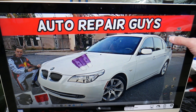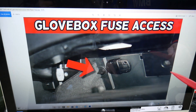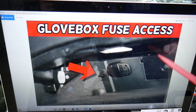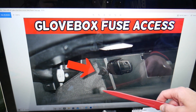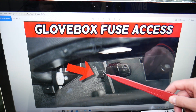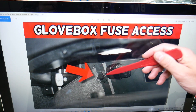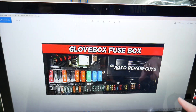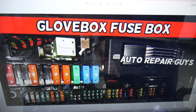The first one we need is on the passenger side. Open the glove box — on the back side, once you empty your glove box (because I bet it's full to the point where nothing else can fit) — on the back side you have one rectangular piece. It attaches with two turning knobs, one on the left and one on the right side. Turn them about 90 degrees, remove that rectangular piece, and you'll see a fuse box layout that looks just like this one right here.